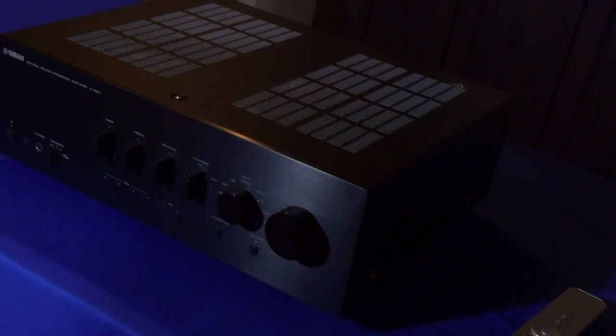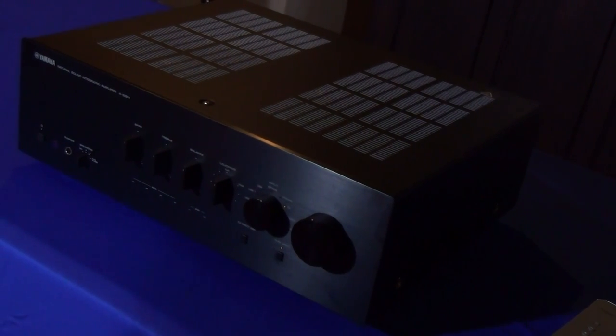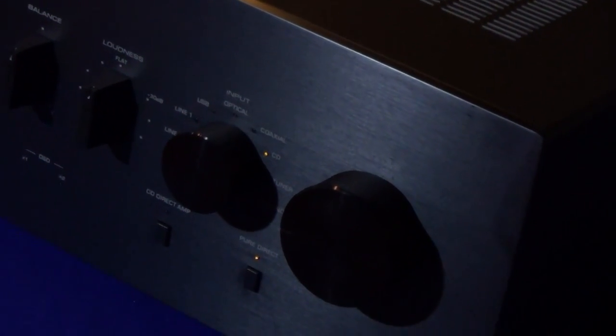It's really powerful. What else can you tell us about the hardware of this stuff? Because it's really exciting. Well, it's not just about the features that we're talking about. This thing has some meat and potatoes in it. When you pull the top cover off, you notice it's got dual heat sinks. Most AV receivers, you get one little heat sink for 7 amplifiers. They actually split it kind of like a mono construction, 4 output devices per channel. So that explains why it's meaty and it could drive 4 ohm loads. And it's got a capacitor bank of 12,000 microfarads times 2. So it controls the ripple really well. It doesn't fluctuate when you're driving it really hard.